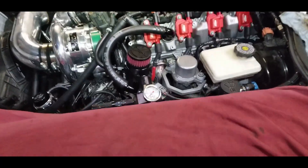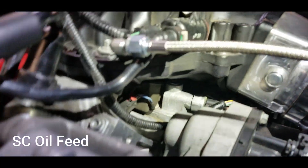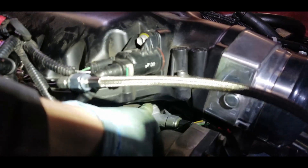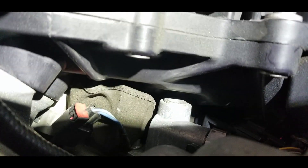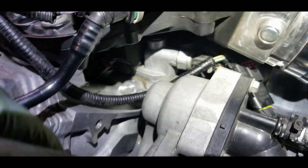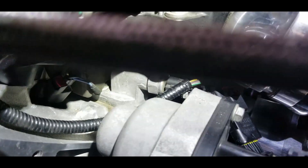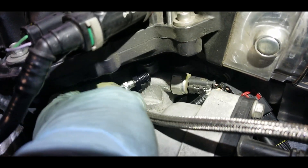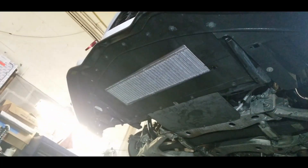Also put some sleeves on the plug wires to keep the heat down. In the kit it may work on a stock intake — there's a port right on top and it comes with a threaded fitting that basically bolts right in. But there's no way I can do that on this intake manifold — it's just too tight, there's definitely no room. So one thing I'm thinking about is pulling the intake off and drilling and tapping the block somewhere on the side, which will allow me to get the fitting in there. That will be my oil supply line.